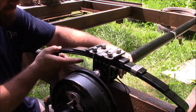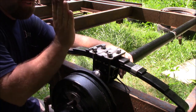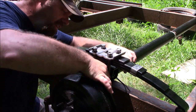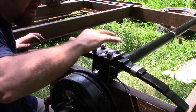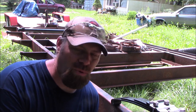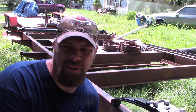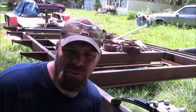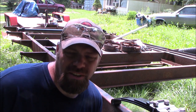Check that the u-bolts are straight up and down relative to the back of the hub — you don't want them cranked out or in on the bottom. Try to push them up against the spring hanger welded onto the tube, or get as close as you can. Once they're straight, crank them down with a ratchet and socket. That's going to do it on how to rebuild a 3,500 pound Dexter axle. This process works on pretty much any trailer axle — 2,000, 3,500, 4,000, 6,000, 7,000, up to about 10,000 pounds. If you like videos like this, subscribe to the channel.